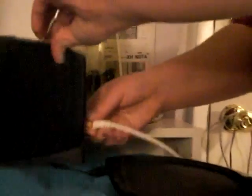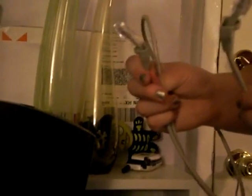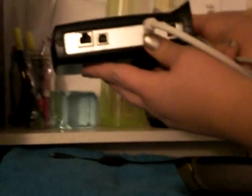So in this one, we make sure it's hooked up. Take the power out, because you don't need that on yet. And then we get our first ethernet cable. Ethernet cable looks a lot like a phone cord — the difference is it's fatter. So if you try to put it in the phone cord hole in the wall, it's not going to fit. That's how you know. So this goes in the back of the cable modem. There's a port and it should say something like ethernet or internet — either way, it's the big one.